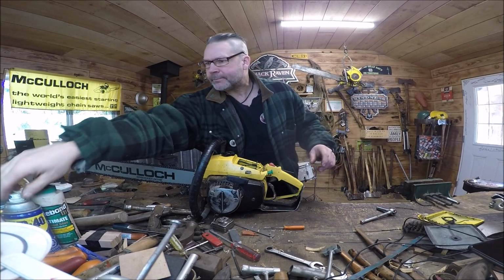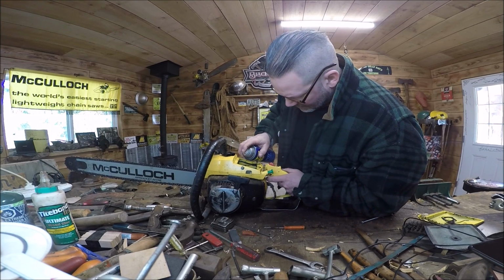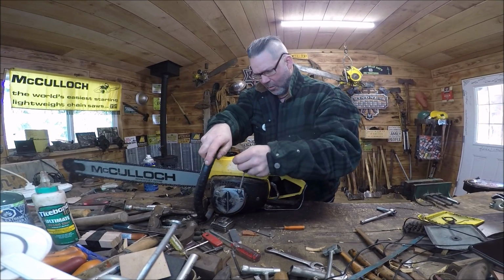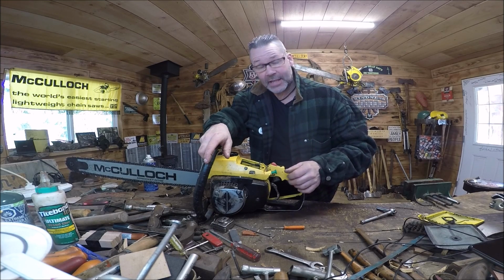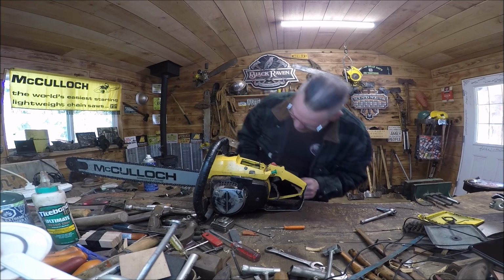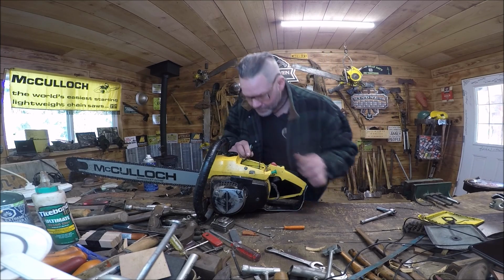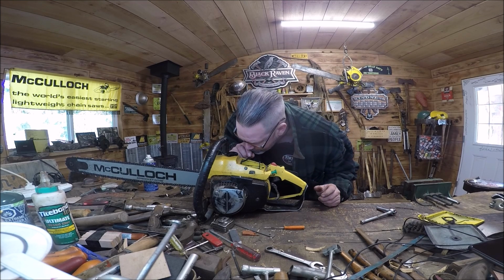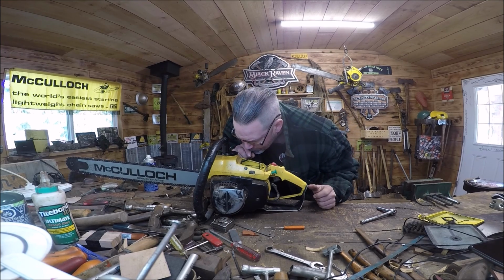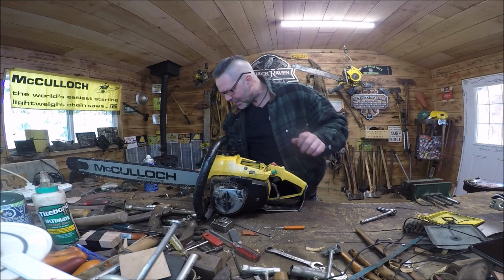Let's see if our pulse line's working. And how we're going to do that is we're going to squirt a little WD in the pulse line. Wow. Must be turned on. It is. It fired. Did you see that? Okay. I just don't know where this fuel is coming from. I don't want to swap this line out. I'm not going to, actually.